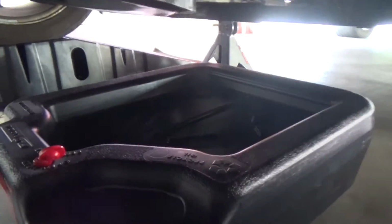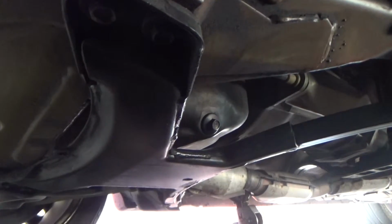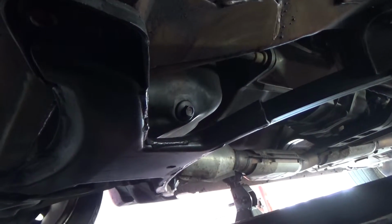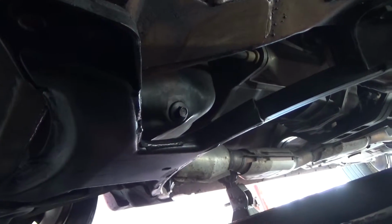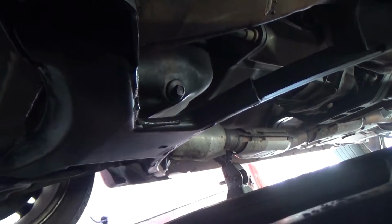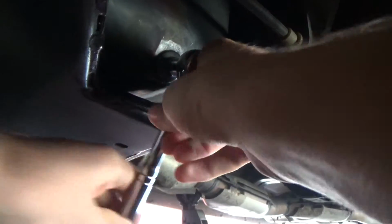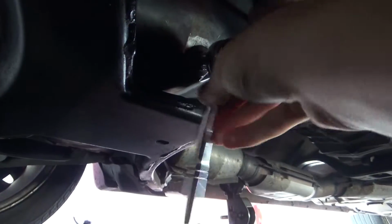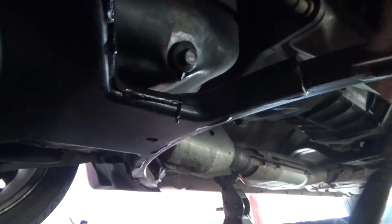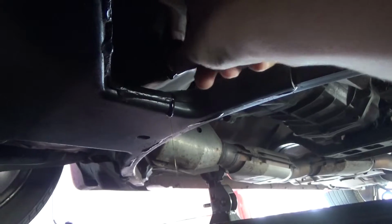Alright, so we're going to put our oil pan underneath the drain plug, and we're going to go get our sockets. Really just kind of feel it out. Your owner's manual should tell you what size the bolt is, and if you can't figure out what size it is, just try them all out and see which ones fit. There we go. Once it gets to the point that you think you can get it loose with your hand, do it, because it's going to start dripping.